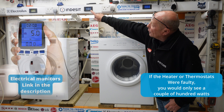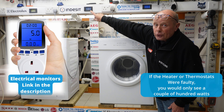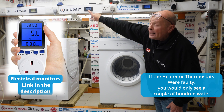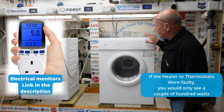I'm lucky that I've got these amperage meters, and I've also done a video — there's a link in the description — to a portable device that you can buy for less than a tenner, which will actually show you the power that the machine is drawing. This machine is drawing 2,200 watts — that is the element combined with the motor that's actually running.